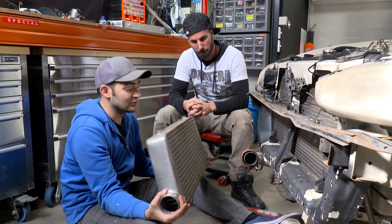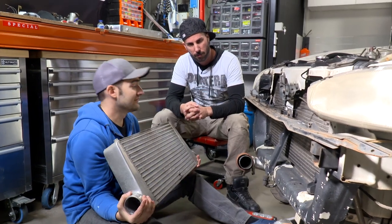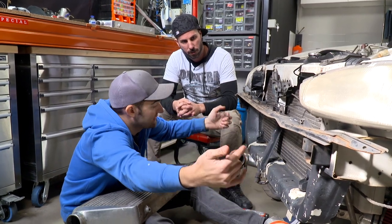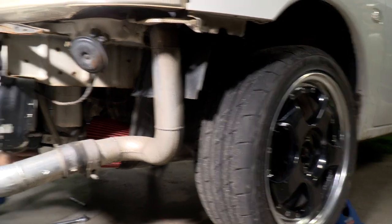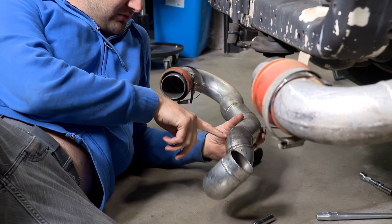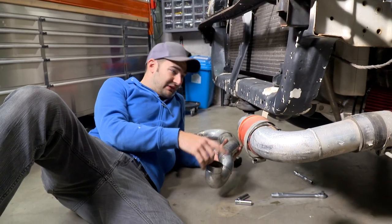What I want to do is package it so much more neatly in there. I'm going to pull that old bumper reinforcement off and fix that, then neatly stick the cooler up in this space, redo the pipes so they're coming around the side and the whole bar will just drop in cleanly. One problem is the aluminium piping has worn away in some areas because it's been rubbing on steel things, going straight through the aluminium.